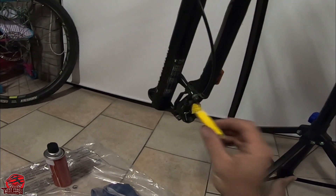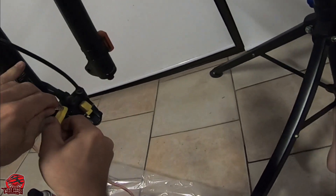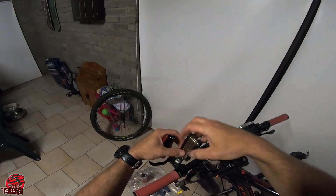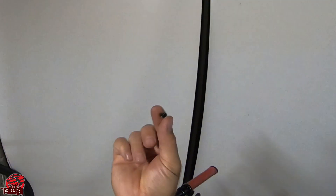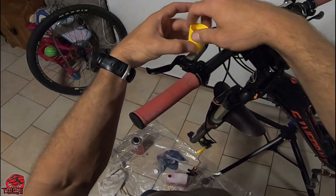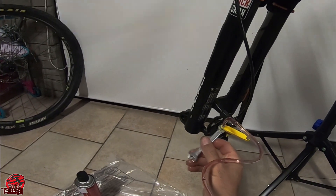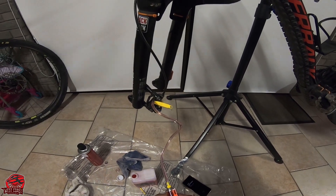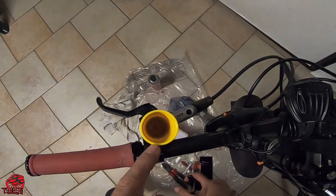Now I'm going to use this little adapter for the pipe. Just unscrew that and if it's loose you will see there is a little O-ring in there — so don't lose that. I'm going to screw in our reservoir at the top, not too tight, it is plastic thread. We're going to push with the syringe at the bottom, and we should see something happen at the top. And if you can see, the oil is coming out very dirty.